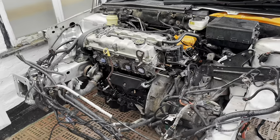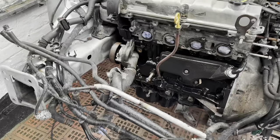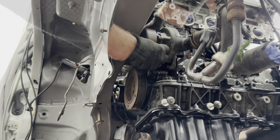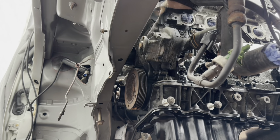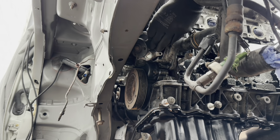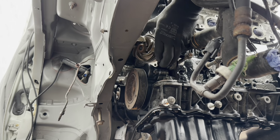Okay - the cam belt, the lower crankcase gasket, the oil pump, and the water pump. These are all tied in together so we're going to start to dismantle and do these jobs as we go. So if you're watching for one particular job, hopefully you'll be able to pick out what you need. First things first, let's take off the water pump. Undo the three bolts, then undo the four 8mm bolts. That's a bit fiddly - it must have been talking to the alternator.